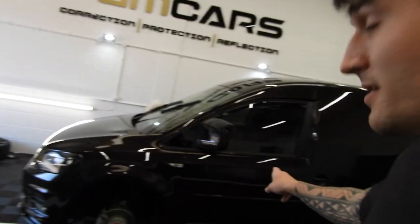Now, the paint level isn't that big, so what me and Kelly have done is we have reduced the scratch as much as we can. However, we try to preserve the paintwork at the same time. So there's still a little thin scratch on both sills. That is obviously not our fault. The reading on this van from new was about 90 microns, which is not a lot for a brand new vehicle. We're preserving the paint just in case we need to polish it later on in its life. So I could hammer this right now and get the scratch out, but I'll have no paint left.